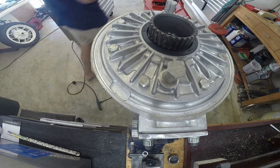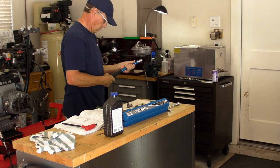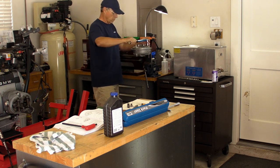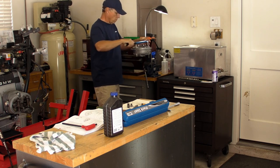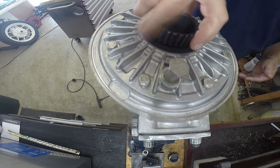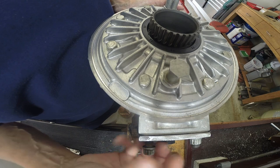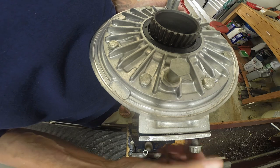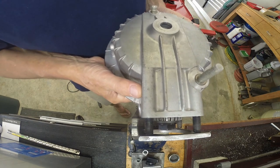As I mentioned before, I have some fancy torque wrenches. This Park torque wrench — really bicycle tools — is my favorite. I have it in 3/8 and 1/4 inch and they're great. Just torqued all those up and went around. That's sort of the final drive cover all buttoned up. You can see the pinion gear turning really nicely. Now I just need to pop it out of the holding fixture and turn it over to complete the installation of the brake arm.